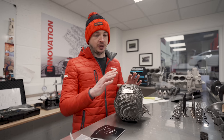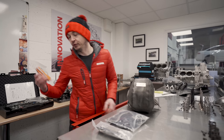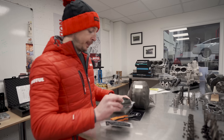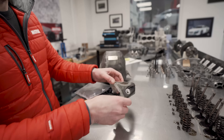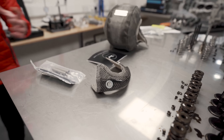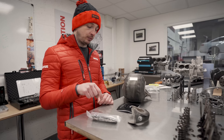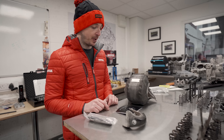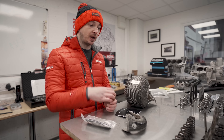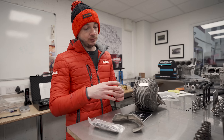We use these on all our builds. This is for mine - we've gone through turbos before. I even went for wastegate blankets as well because I wanted to try them. It's like a little mini blanket that wraps around the valve part of the wastegate, bridging the gap between the exit of the turbo and the intake into the impeller. You can get water-cooled wastegates as well, but this just helps stop radiated heat. There's already a heat plate there anyway, but this just helps.